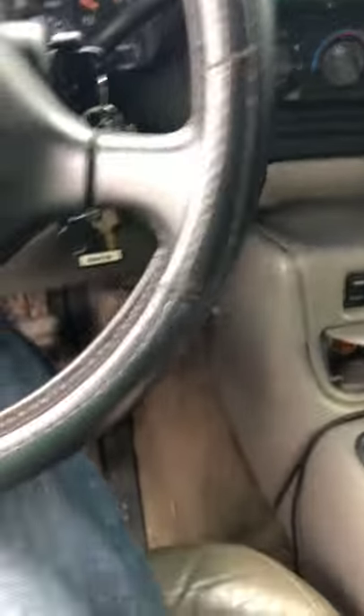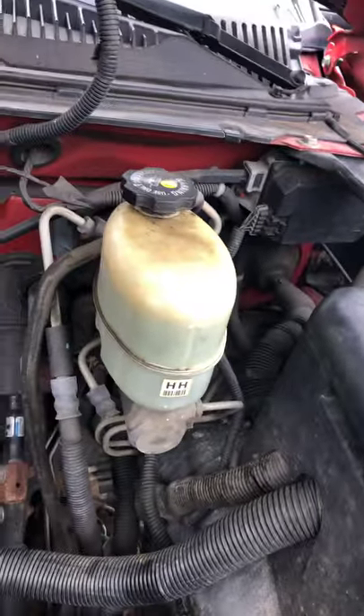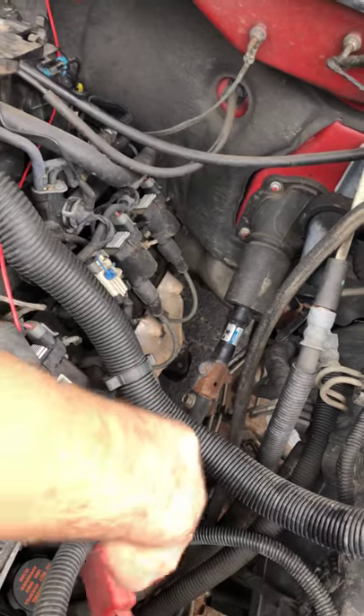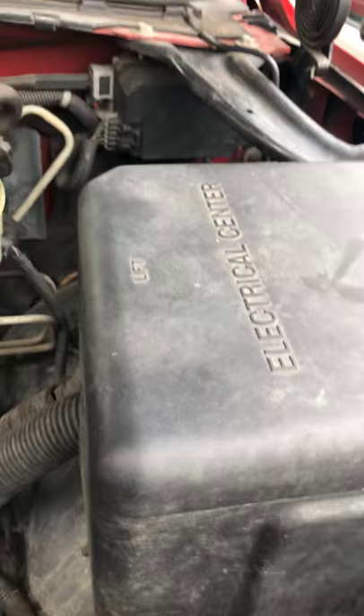It's not the battery because I tested it with a light. I did add a ground wire — this truck's got a three-inch body lift on it, 6.0 motor. To test the grounds, I hooked up a jumper cable: red wire to red wire on the battery, then black on negative, and black to the chassis — so the motor is grounded to the body and the battery.